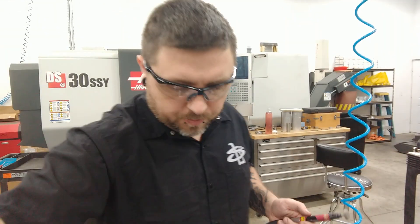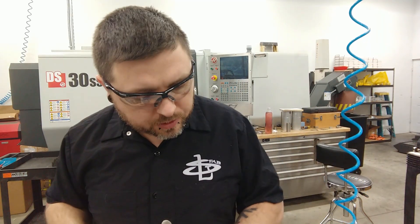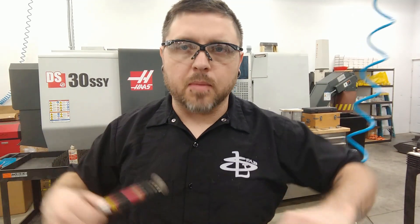Alright guys, now that I'm done with the combustion chambers, I'm pretty happy with them. They're satisfactory, so I'm going to go ahead and clean up my whole mess from porting here and give this head a really good once over in the sink, clean it up, and then we'll start doing some cleaning up some valves and some lapping.